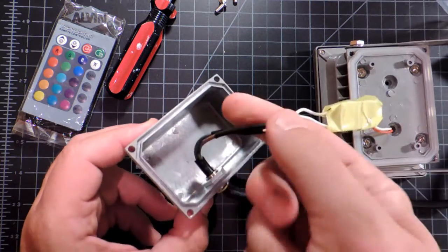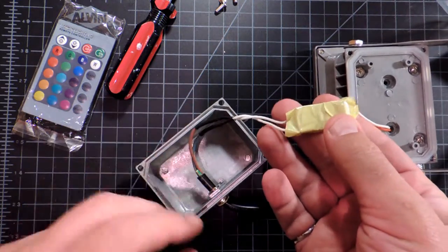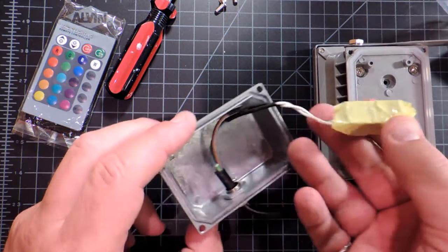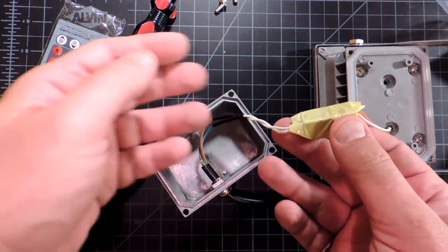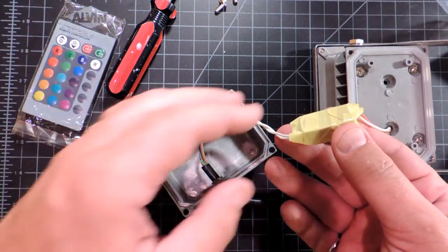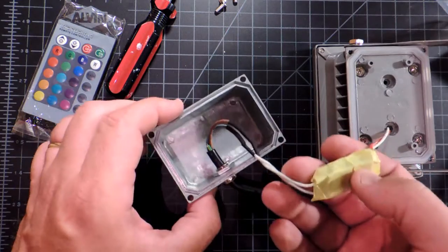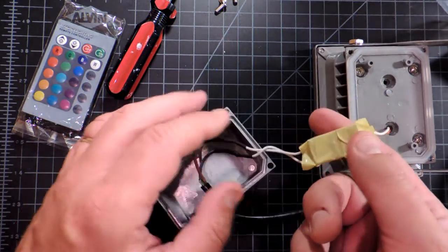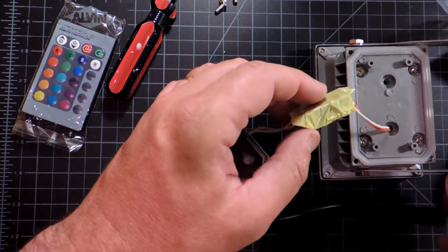We have all the power leads here, and it's not even double insulated. You might get away with not having a green ground wire if it were double insulated — though you'd need a different plug. Double insulation means that a single failure of insulation won't cause a failure of the whole product. You can clearly see that's not the case here. Should one of these insulated surfaces break, the product would become live on the case.